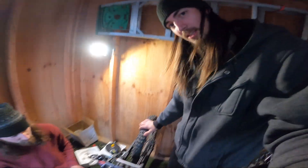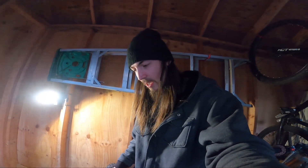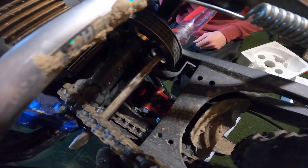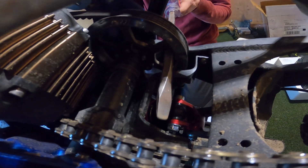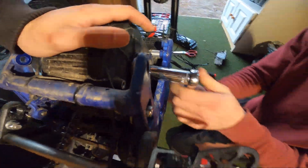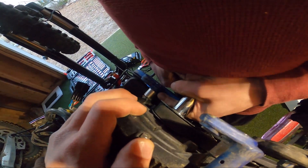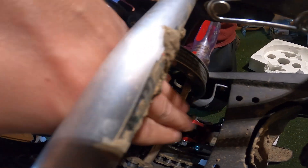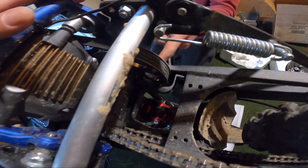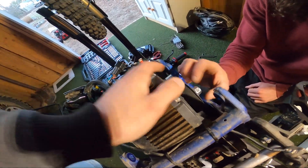We were trying to get that nut off and we kept realizing that the back tire was spinning — even holding the brake with everything I had, it still spun. So we went ahead and put a long screwdriver through the belt all the way across, and now when Kyle puts tension on it, it doesn't move at all. You want to use a screwdriver — do not miss that step. You will be sitting here forever trying to take it off.